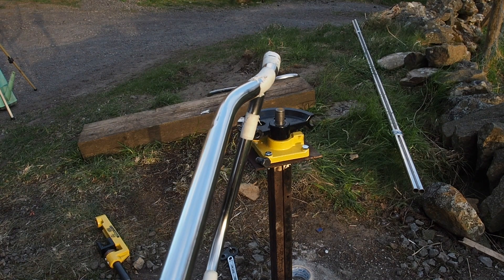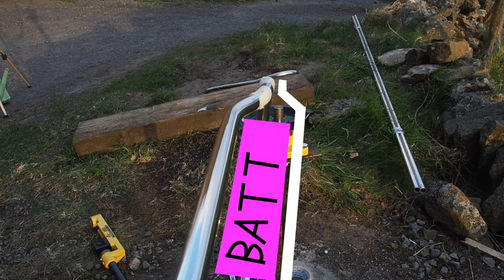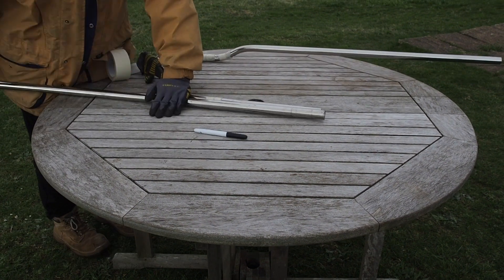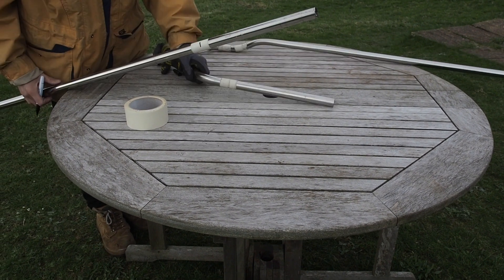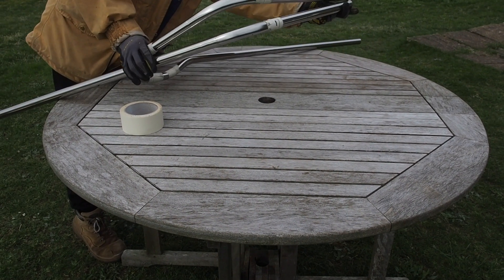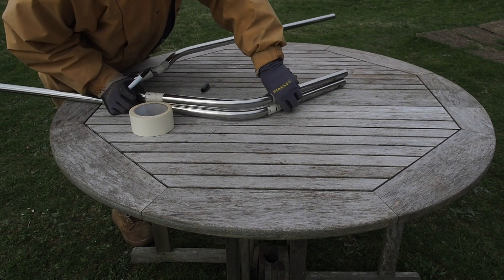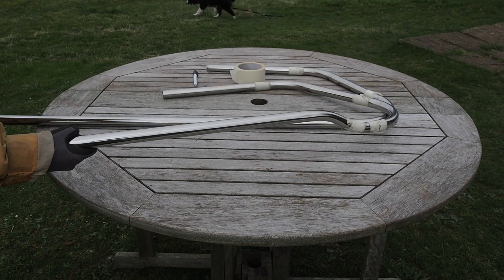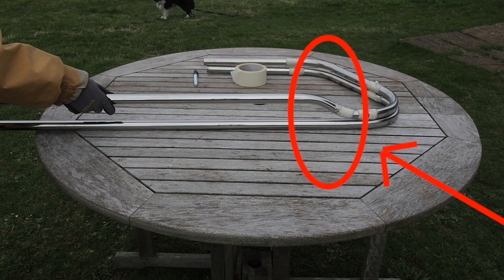That section will be doubled up and mirrored on the other side so the battery can fit down the middle. Now I've got a section of the frame nearly complete — I'm just going to mark up the next steel section so I can repeat that on the second half. I've matched them together to get the exact same bend, and the second half just needs the reverse bends to go around the battery on top.